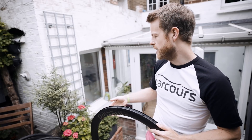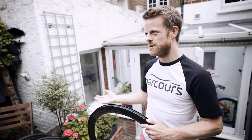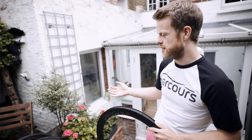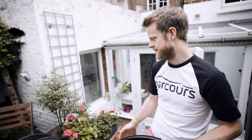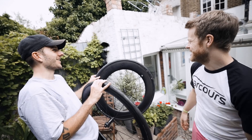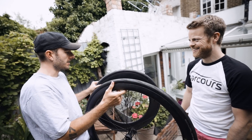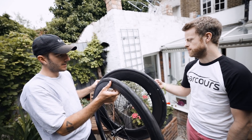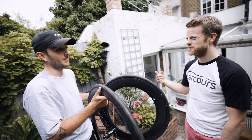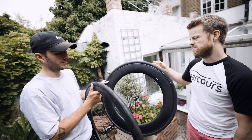It's not very much pressure, but if you're running a wider tire you probably don't need that much. If you're running a 28 tubeless, 60 psi is probably fine. There will always be people that want to run at a higher pressure, so it's going to be interesting to see whether 72 and a half psi is a limit or whether we can go higher. It's not a perfectly scientific test — the wheels are different depths. In terms of tires, we're using matching Schwalbe Pro One — both 28s, one's a slightly newer model than the other just to be able to get it on, but it's pretty close.